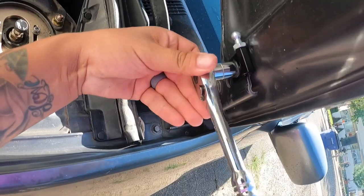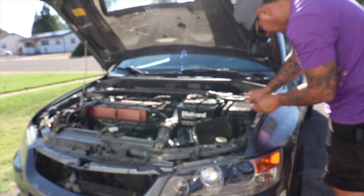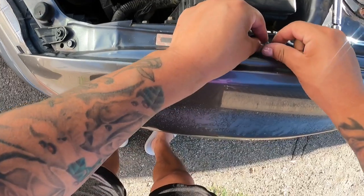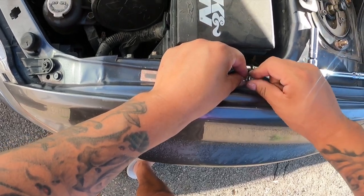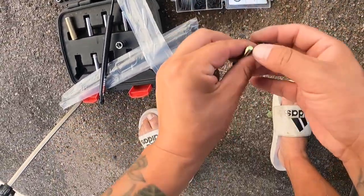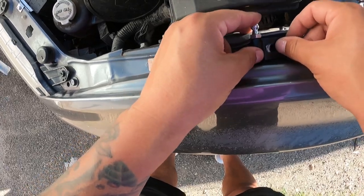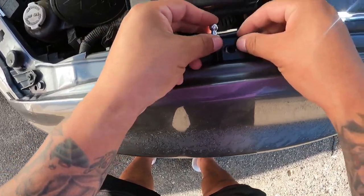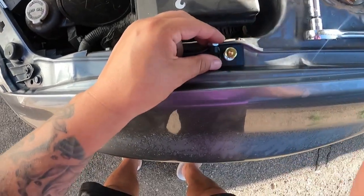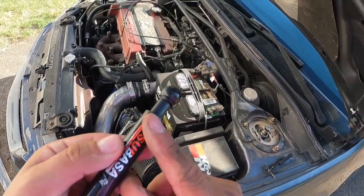The fender mount was a little trickier because there's a small lip on the inside where the aluminum fender protrudes upward. My first attempt used a replacement bolt with a lock nut washer, but they were too short. I found a longer brass screw from around the house, test-fitted it, and it fit perfectly. But I still needed to elevate the hinge a bit, so I used a couple of rubber shims underneath — you can also use washers, just get creative.